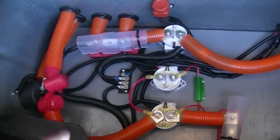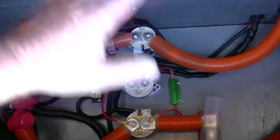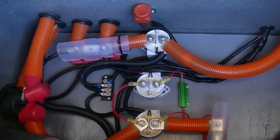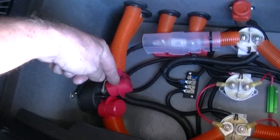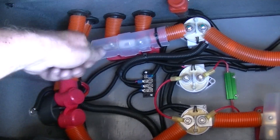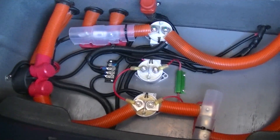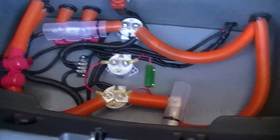And that's how all that stuff works. This is low voltage, 12 volts. I have this open because when I put the cover on it you can still see through it — I want to make it so people can see what's going on. I have all my tools covered with heat shrink so there's no zapping. This would be your worst zap right here since this is 400 volts and that's negative. If you hit a wrench taking these off, it could go bad and get very smoky — and it's really hard to get the smoke back in after you let it out of the electronics.